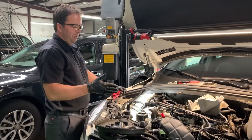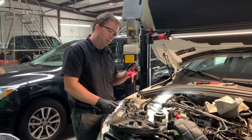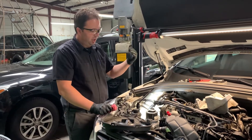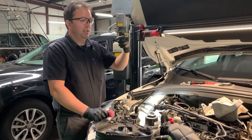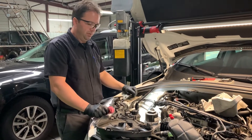This vehicle actually has a technical service bulletin that Volvo put out to diagnose and resolve this oil leak. If you raise the car up, you'll see oil leaking, maybe dripping from the crankshaft pulley — just a small drip from the crankshaft pulley in front of the timing cover. This is very likely the culprit of your oil leak.